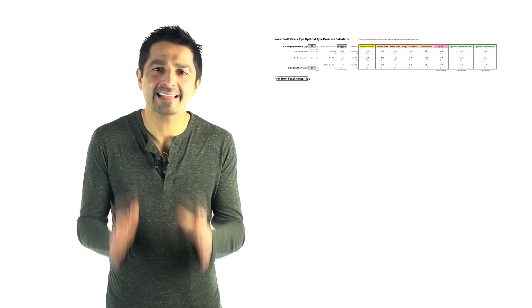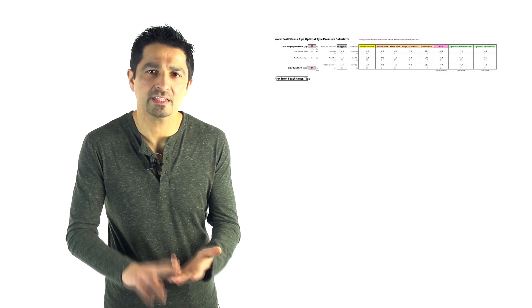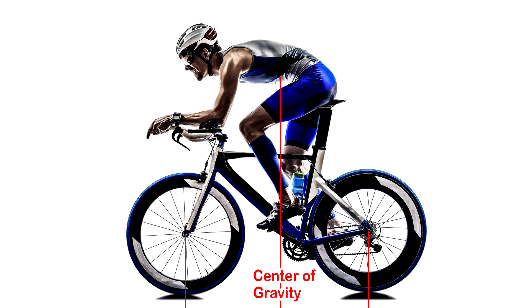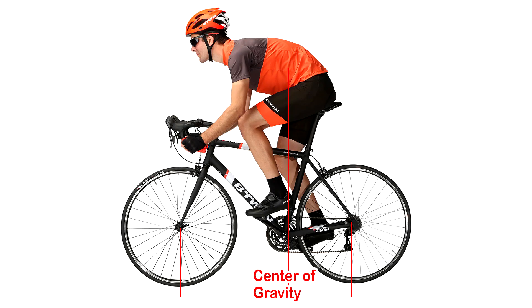To be really accurate, I need to know your exact weight — your bike weight including wheels and tyres, and your body weight, since the rider's body weight takes up most of the mass. The vertical load doesn't split exactly 50-50 front and rear. Time trial position gets close to 50-50; mountain bike or upright positions give around 35-40% on the front; a typical road position gives about 45% front and 55% rear.